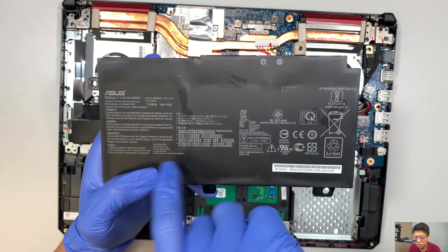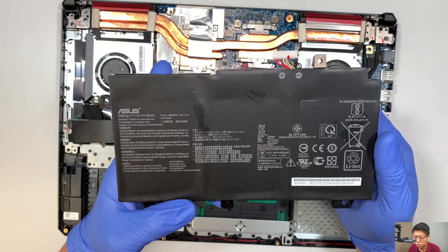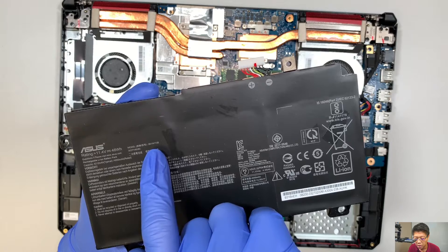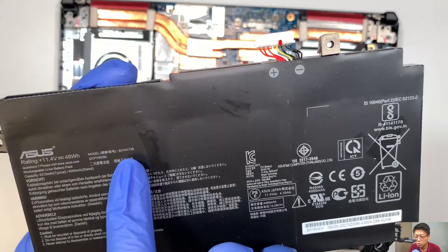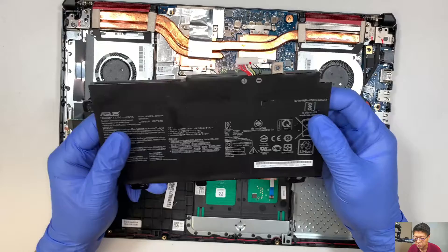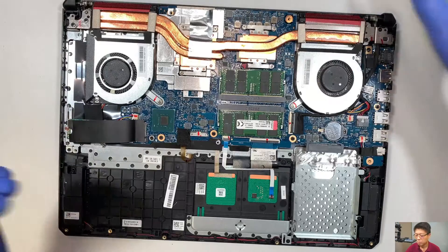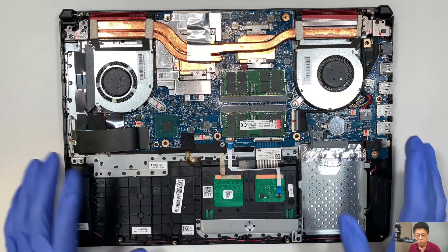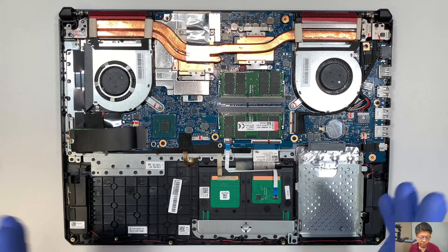If your battery is not holding a charge, or if your battery is swollen or there's a lump on it, this is where you want to replace the battery. The model number here says B3-1N1726 — that is the replacement battery model you need to look for. I'll link it in the description. Usually eBay sells them, not Amazon, because of the lithium-ion battery — they might not ship to your location. I'll try to get the link in the description below so you can easily buy the right items from the right website.